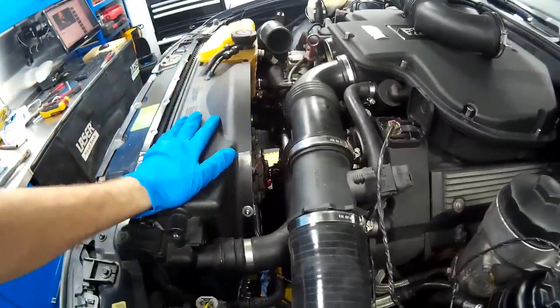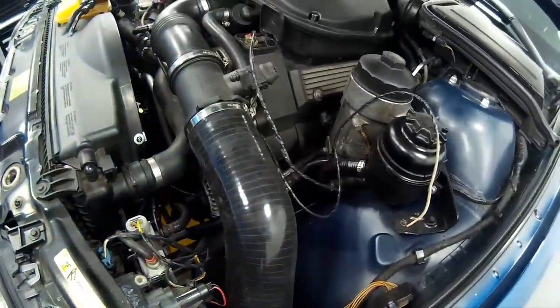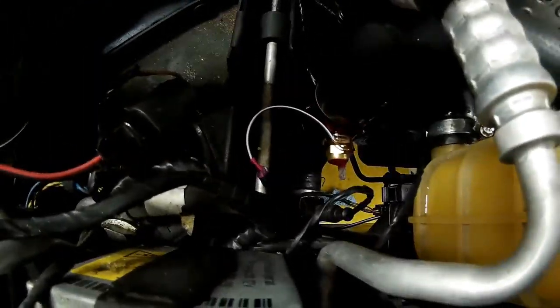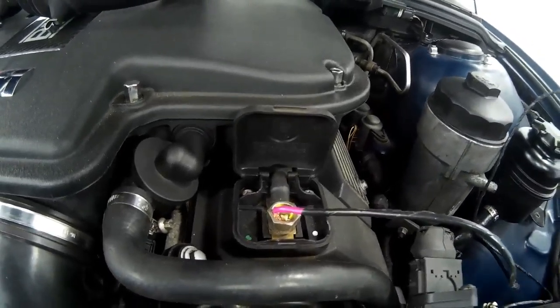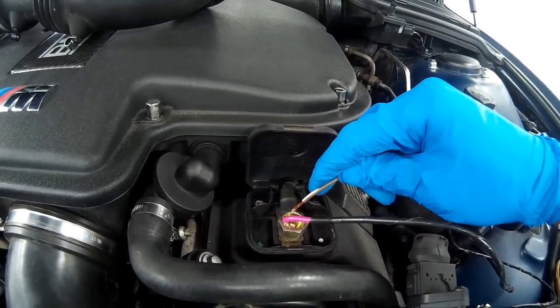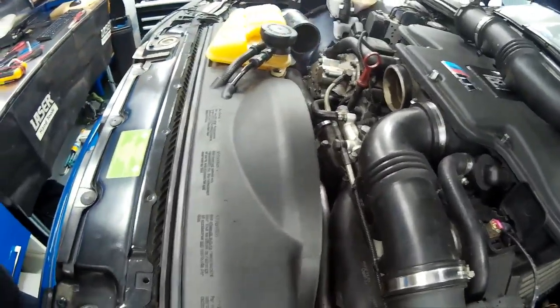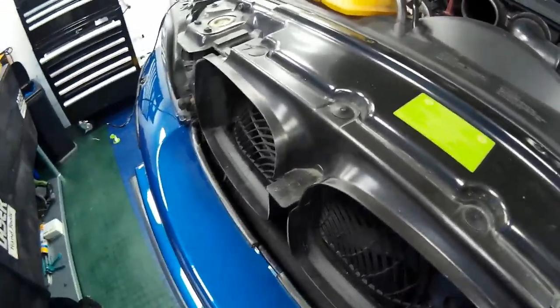Once you've refitted the cowl with the fan motor in and put the expansion tank back on, fit your earth points on each side. Then you can test the fan — the easiest way is to take the speed terminal off the fan switch and short that direct to ground, put the live for the fan on the positive terminal of the battery, and then operate the relay switch. As we can hear it spins really freely — sounds quite loud and it's pushing a fair amount of air around. Once the cowl is surrounded so it can only suck air directly through the radiator it'll be a lot more efficient, but at the moment it sucks plenty through the radiator with no issues at all.